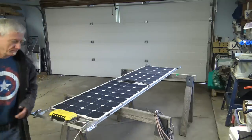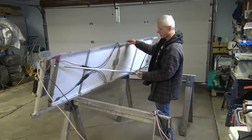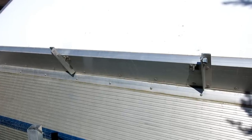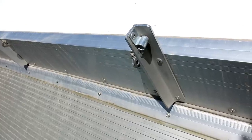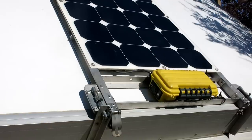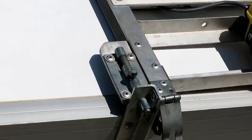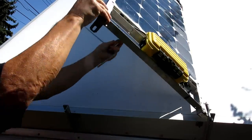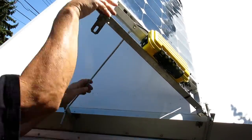I also did some changes underneath. I now have a swing-out support with a chain so it can be brought out and held in place. As for modifications to the trailer roof, I added four supports where the panels go, each riveted in place and all having holes for the spring bolts. I also used the strike plates from the barrel bolts to guide the bolts in place. With the barrel bolts acting as pivots, I can easily change the angle of the panels for more sun exposure.